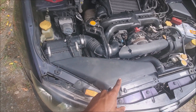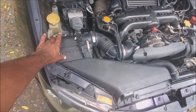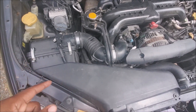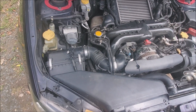Subaru parts for whatever reason are ridiculously expensive. An intake — a pipe that goes from the airbox to the engine with a filter and a flange to bolt on the MAF sensor — we're looking at four to five hundred dollars. No other manufacturer for these affordable-type cars sells parts so expensive. With a MAF sensor, anytime you change anything in the MAF tract — air filter, intake, intercooler — you typically have to recalibrate the MAF sensor scale. With a speed density system you don't have to do that, as long as volumetric efficiency stays roughly the same, the tune for the most part does not really change.